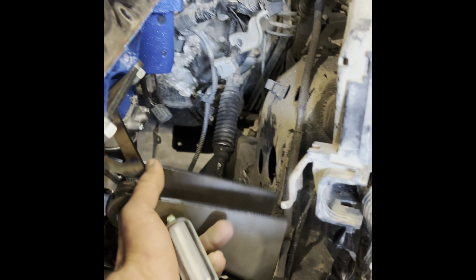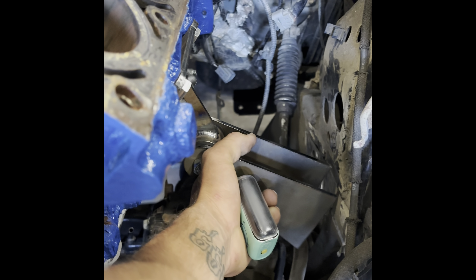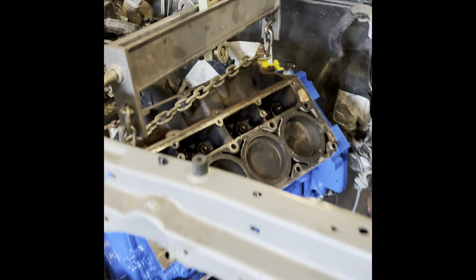As you can see, this is not sitting centered, but they're basically there. The problem is I have to angle them downward so I clear the differential with the oil pan, because that's really my big concern. So we're cutting brackets — cutting brackets to make these work. You'll see that when it's done. That's another thing I'm cooking on. Hey, it's the end of this video — like, subscribe, comment, bye!